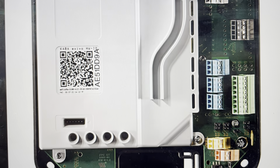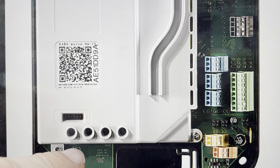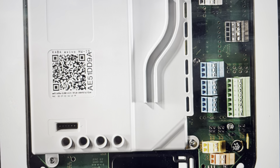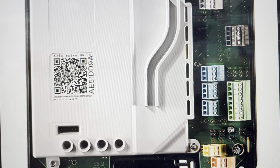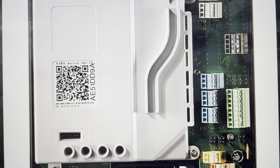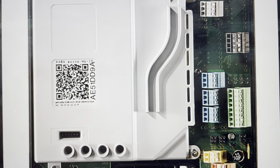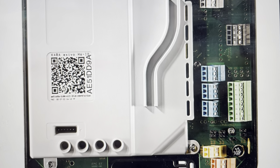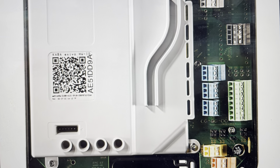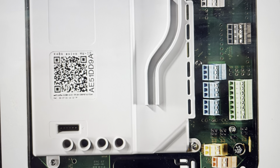What we're going to need to do is come down here and find the FRES button, the little FRES button, and press it and hold it. You're going to need to hold it for 10 seconds. The little LED light is going to go through a whole series of colored flashes, and when it finally gets to the end and is flashing red after about 10 seconds, the entire system will be wiped and restored to its factory default settings like when it came out of the box.